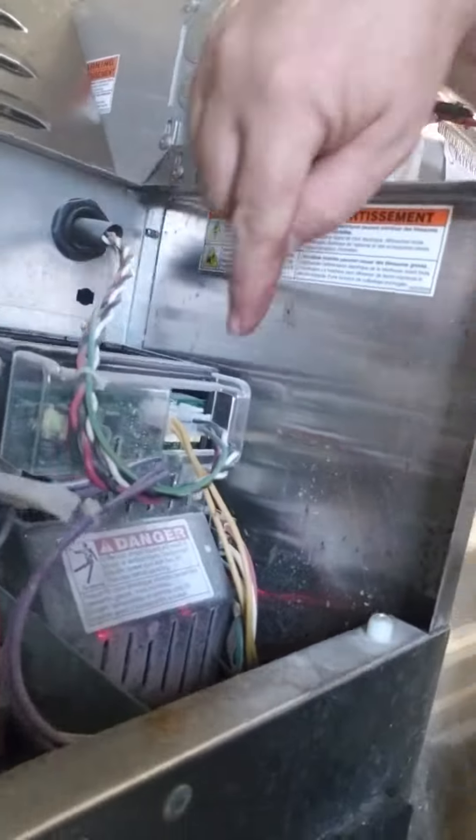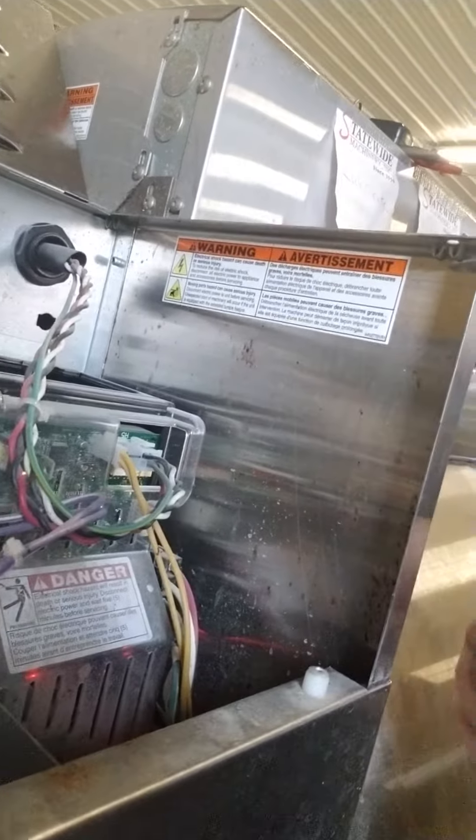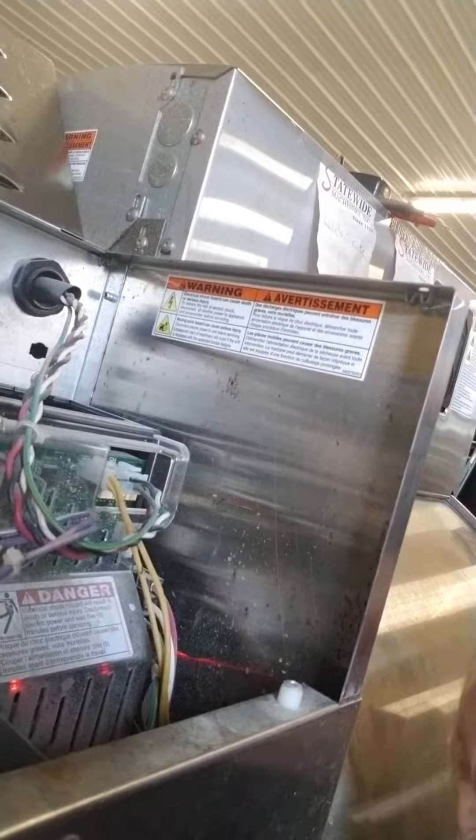So there's two little yellow wires here, right here. I'm going to take those off and check them to see if I have around 300 ohms resistance coming back through those while my motor's turning. If I have that resistance, then the motor's fine and the drive is bad. If I do not have it, then the motor's bad, and hopefully the drive is good. So that's an ED-03 error code on a UWN-065.